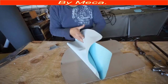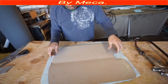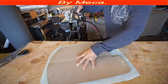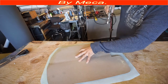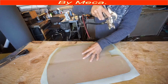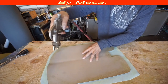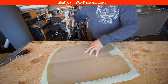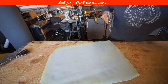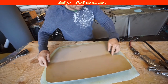I forgot to mention — I put about a quarter-inch thickness of foam on the board. I use upholstery foam and put that foam in there, then put the material over it. You have to cut the material with one inch to one and a half inches extra all around. This vinyl material doesn't stretch at all. Fabric is very easy — a piece of cake. Leather takes more time. Suede looks nice and is easier to work with.